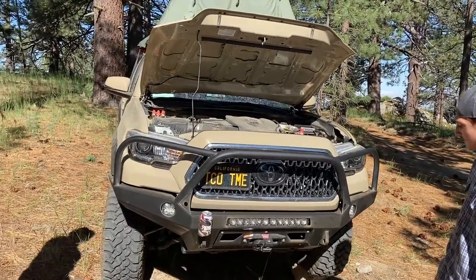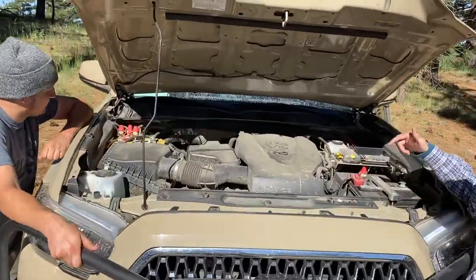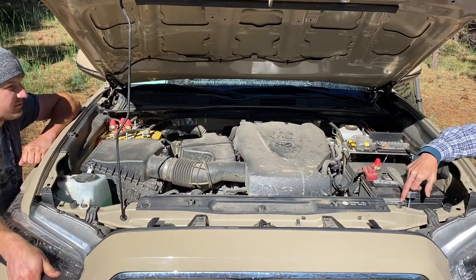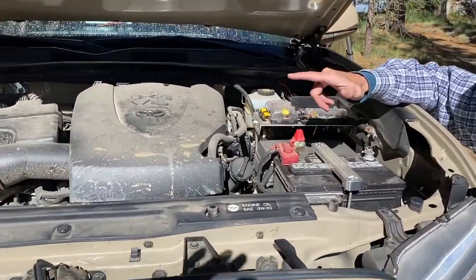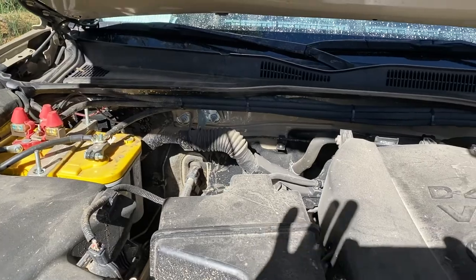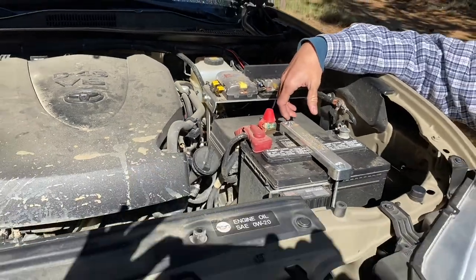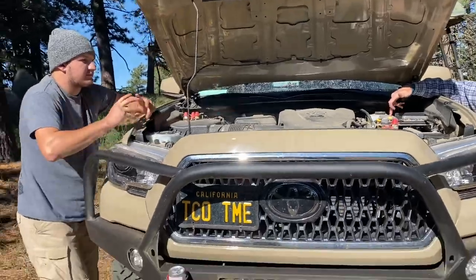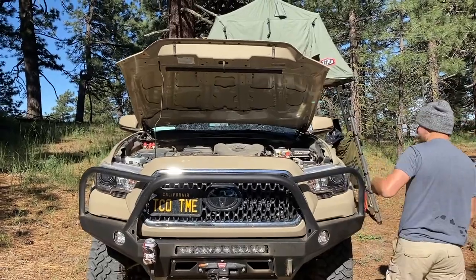I think you were telling me you did your own battery system? Yeah, we've got the Off-Grid Engineering dual battery tray set up here. I went with a Redarc BCDC 1225 charger, which allows me to charge that battery completely independent from my start battery. This truck has a variable voltage alternator, so a direct link between the batteries could lead to charging problems down the road. Backing that up, I've got a fuse block with a Switch Pros controller that goes into the dash.